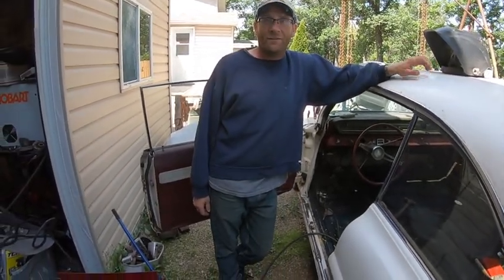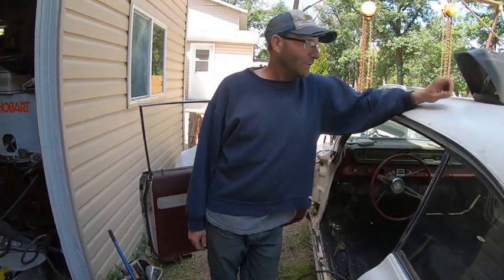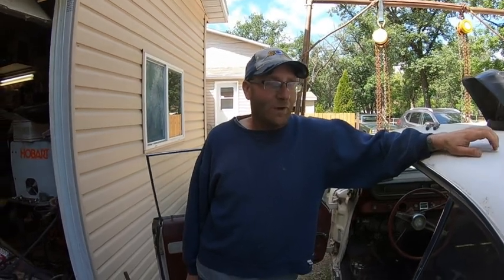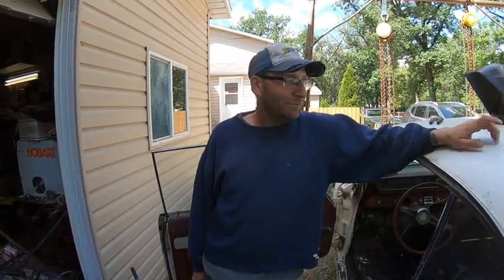We've got to go get an engine maybe for this, maybe might not be for this. We don't know yet. Could be a turd, could be good. It's a 327, it's a short block. I don't know the history on it. The kid that I bought off didn't know the history on it. His dad passed away, I think, a few years ago, so it's been sitting in dry storage, so you people know about as much as I do. The only thing I do know on this block, and I didn't realize until afterwards because I took a picture of it, on the pistons it's got a stamping, L2211, so you Chevy guys should know what that is. So I'm thinking it might not be a good engine for this. Who knows? Price was right, so we're going to go pick that up in about 20 minutes.